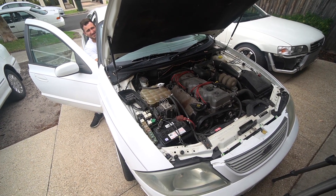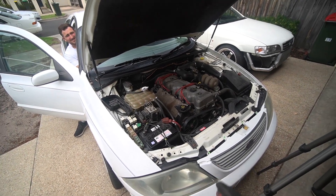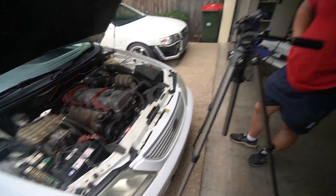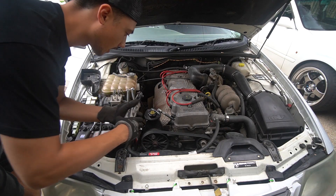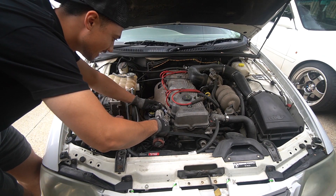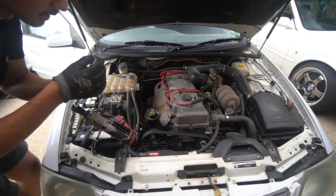Keep turning it... all right, stop. No more fuel — fuel deleted. So we're just going to take out the spark plug. Spark plug is out — why does it look like it's running lean? What the hell? My plug is literally white. Can someone explain that? I actually don't understand why it's white.